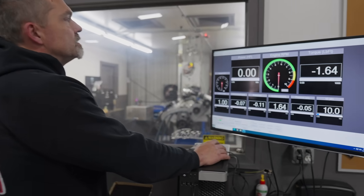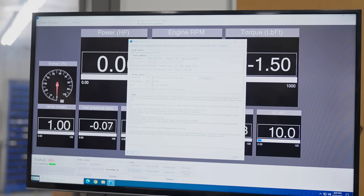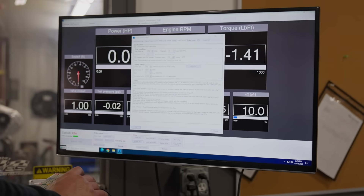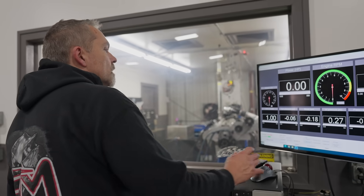The dyno has caught it and learned exactly what the load position is. I'm going to sweep it up to 5500 RPM — just a short sweep test. We'll come in with a steady load, listen to it, make a short sweep, then pull a spark plug and take a look, see what kind of horsepower it's making through this lower RPM sweep.